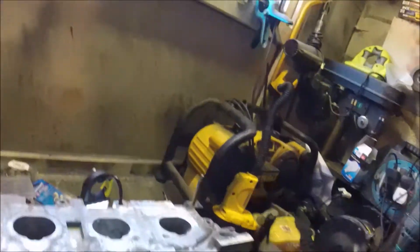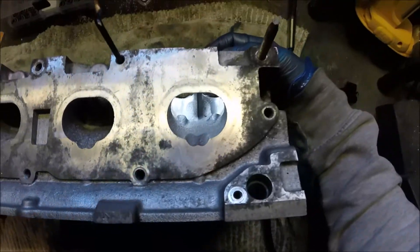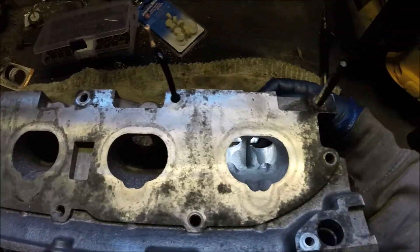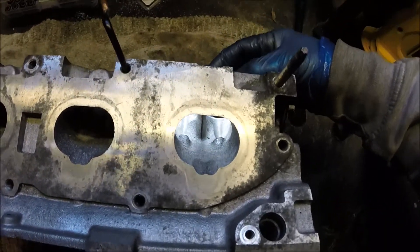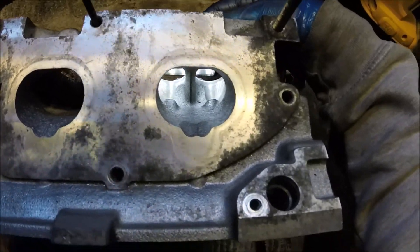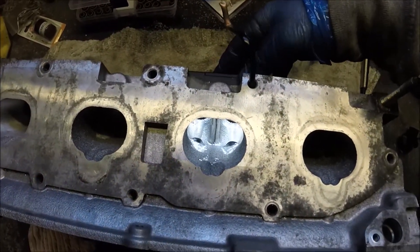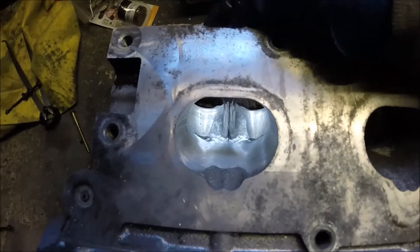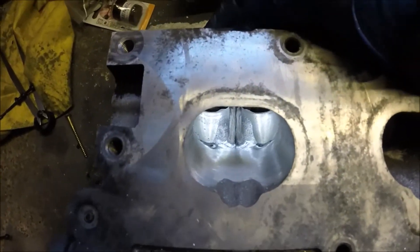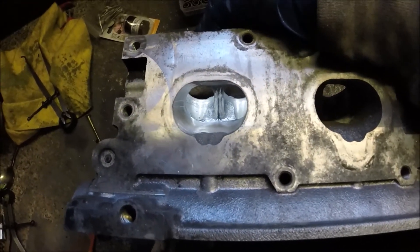Let me show you a little bit of what I've been doing so far. I'm using a GoPro with no back view on it, so I just have to hope you can see. If you look into that port — that's the standard one. I did start to take a little bit off there and then thought I'd better get some footage before going further. The first stage is to flatten down the humps you see before the valve guide. On number one here, you can see I've finished taking a small amount off the valve guides, angling them up, and a bit of sanding.